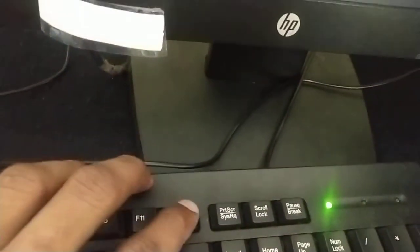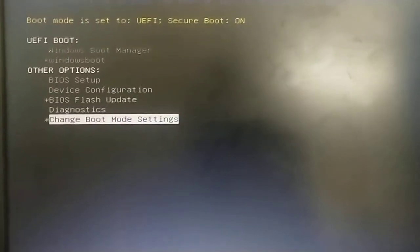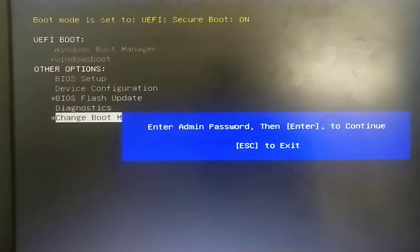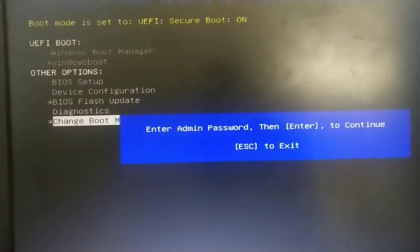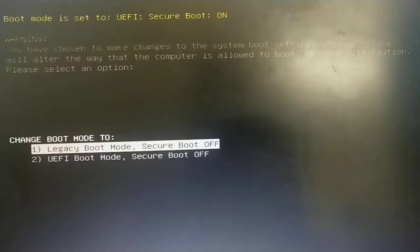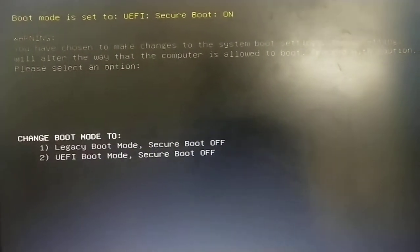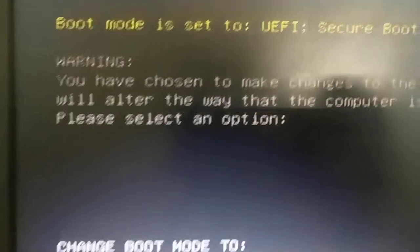Just press enter and just press F12. Now it will show like this. Just go to change boot mode settings and then type the admin password once more, then press enter. Now you can see here there are so many options and this is the actual boot mode